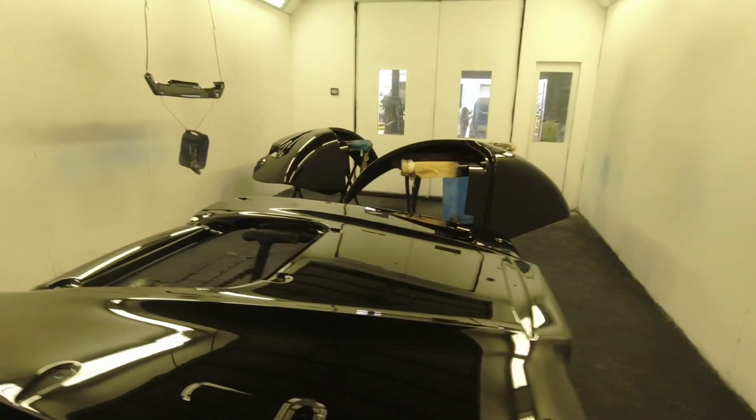and just get the nice finishes. So, hope you've enjoyed the video on a little bit of base coating and clear coating with the Devilbiss spray guns. We use the DV1S to do the little badges. I use that to do the plastic primer, the silver and the clear coat on the badges. And then we use the DV1 to do the clear coat on these in here. And I use the GTI Pro Lite on the 1.2 to do the base coat on these bits on the black.